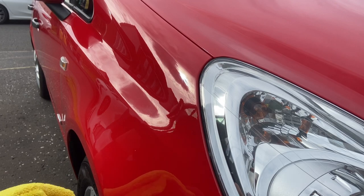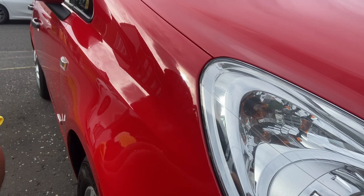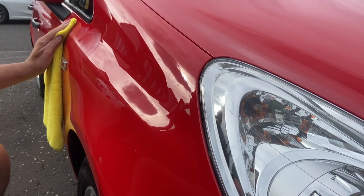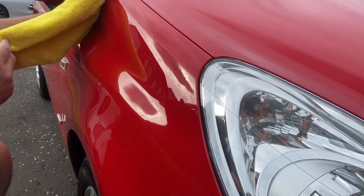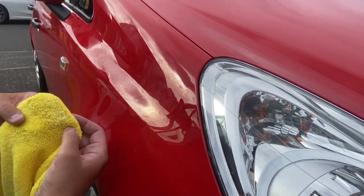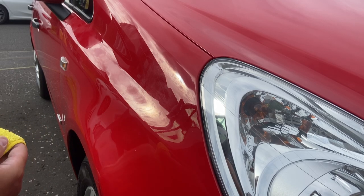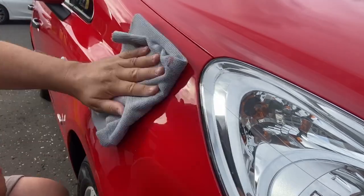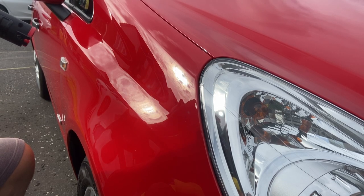Now, it's all very well using a polish with a machine polisher, but what is hand application like? This takes me back to the days of Mer polish and a microfiber - and I'm happy to report it's nothing like that. I'm going to apply this working in circles with the plush side of a microfiber, then check with the LED light after buffing it off to see if it's knocked out any swirls. Just to note - Vauxhall red paint used to be two coats of single stage paint, but the Flame Red is clear coated, so there's no red colour transfer to worry about. The hand application didn't feel like it was doing anything at all - you'd probably need a foam applicator and arms like Popeye. The light confirmed it, so let's break out the three-inch polisher.